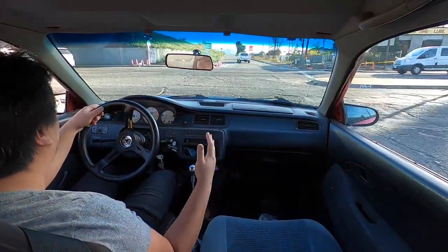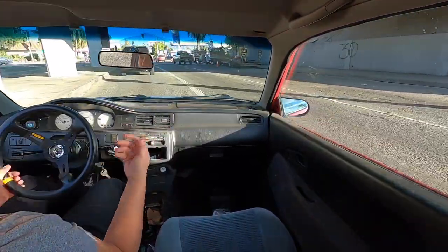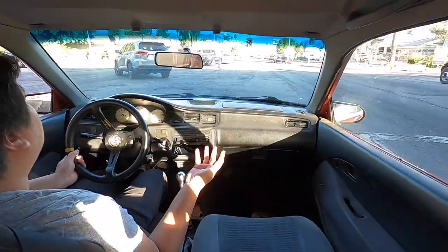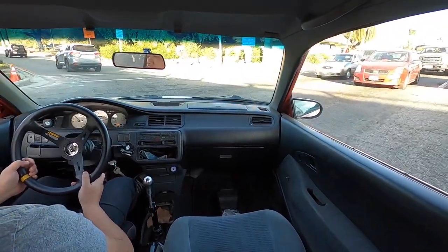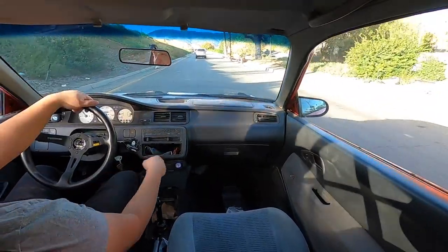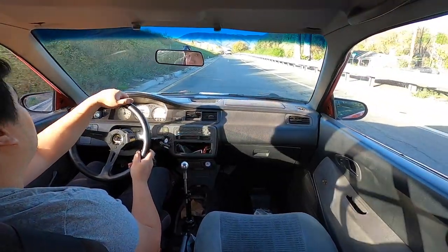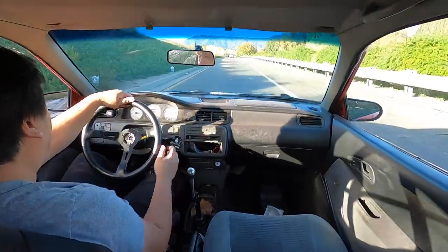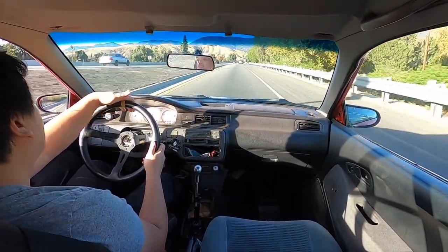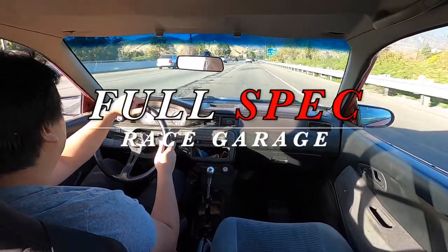You're going to smell the brake pads initially but that'll go away — it's totally normal. As long as your brake pedal doesn't go all the way to the floor, you guys should be good. When you come to a complete stop, don't hold on to your brakes — just let it go if you can. The reason is when you hold your brakes it overheats the pads. That's pretty much all you have to do. See you next time.